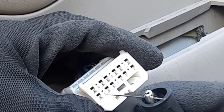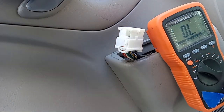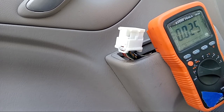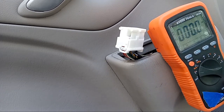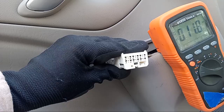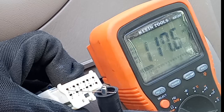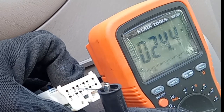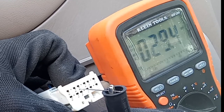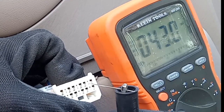We just verified that there are five good grounds on this harness. Now we're going to test for voltage. You'll need the key on or engine on, either one. Turn your multimeter to volts, DC, direct current. You'll need one test lead connected to chassis ground just like the other test. Now we'll probe each connection point for power. We're looking for 10 to 12 volts. This master control switch has about four functions, so we should see about three or four pins with voltage on them. This master switch also has lock and unlock, automatic window up and down for the driver, and the lock function for all the windows.